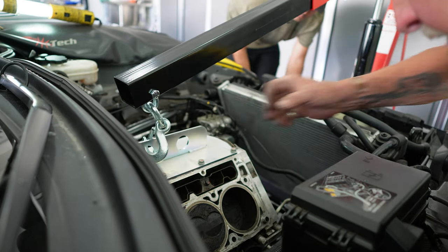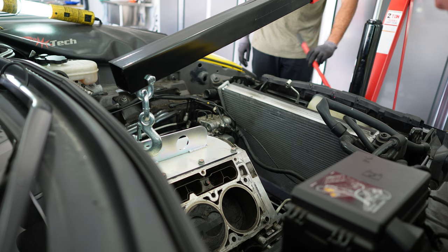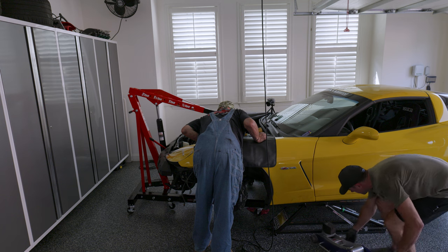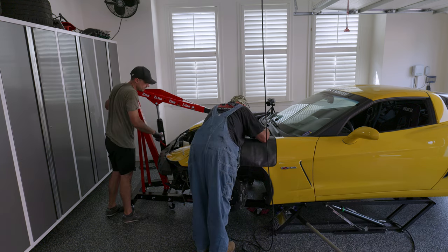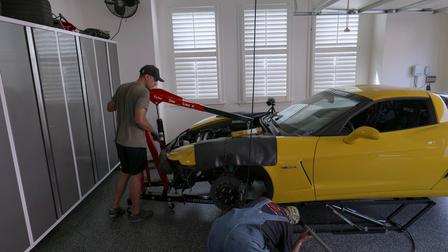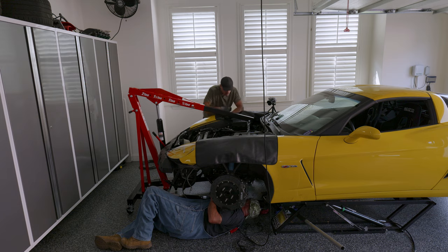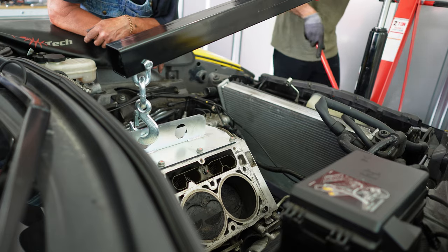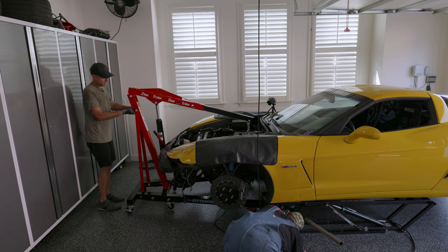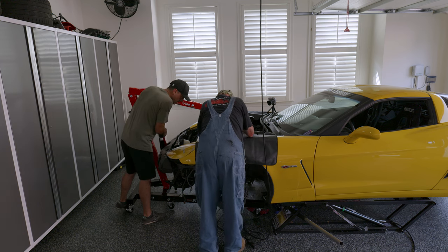Sometimes you have to tilt to get this. She's moving — kind of stopped moving, didn't it? I'm going to use this floor jack to support the torque tube so that when we remove the bell housing, the torque tube isn't just hanging there. In order to get the clutch free of the input shaft on the torque tube we need to slide the engine forward about three inches, but we can't because it's being blocked by the studs for the motor mount.